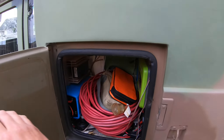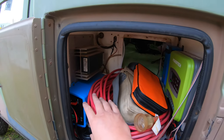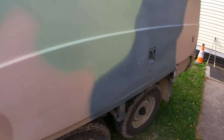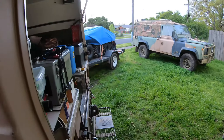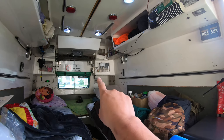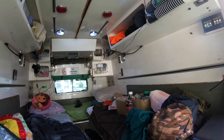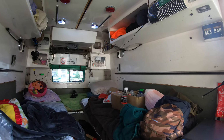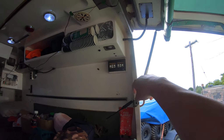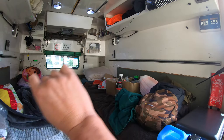We can wander around in here with all the junk stuffed in. This is the 24-to-12-volt converter that isn't running - it previously ran a suction pump, but we generally use that for all the 12-volt converters to charge our phones. We don't want to be loading that up with the fridge all the time. Up the very back corner there are a couple of NATO mil-spec plugs, which I have connectors for, so I'm going to connect to one of them. That also means they're disconnected by a relay when I turn the master light switch off, which will be nice. Currently I've got a little mains inverter on there - a 150-watt one for running fast-charging gear on my phones that can't run off a 12-volt system.